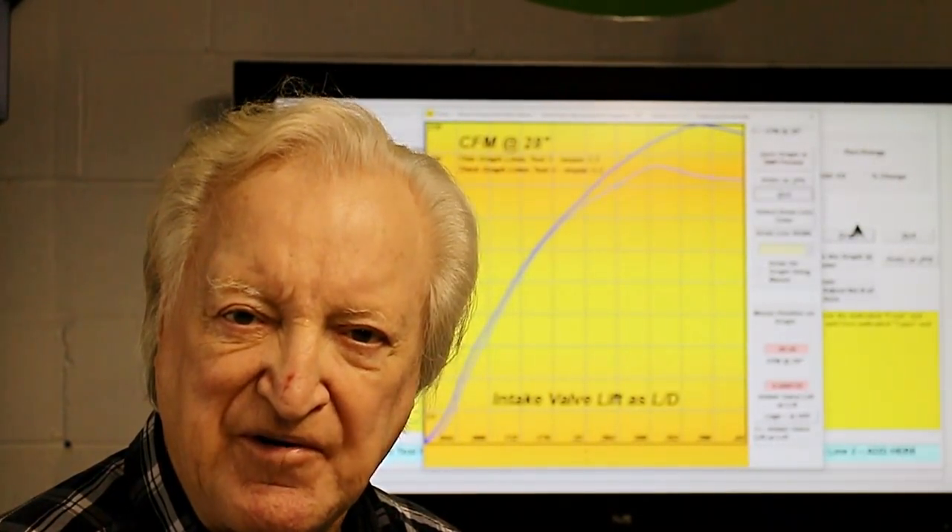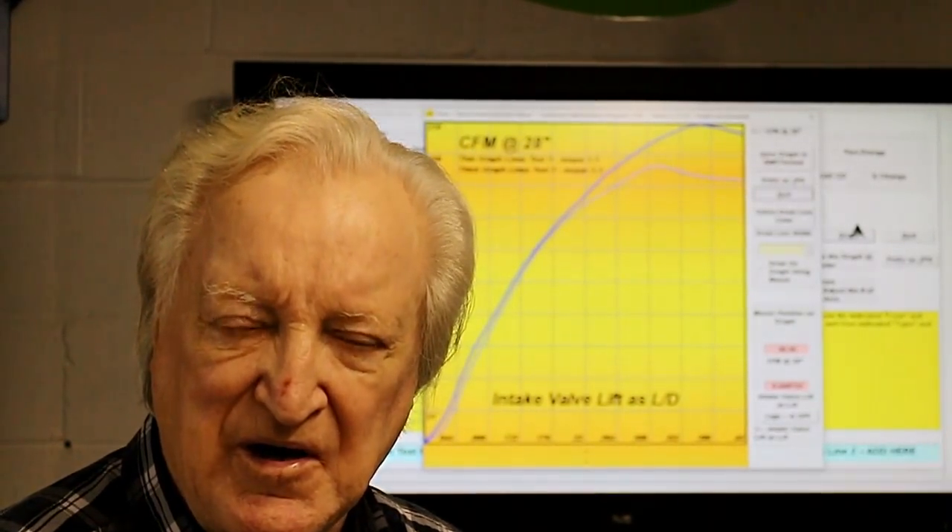So, why a 39 degree seat? It presents area to the cylinder faster and it makes the valve look bigger at low lift. But it's not just a case of doing a 39 degree seat versus a 45 — I'm going to talk about seats in an upcoming edition. Suffice to say, the 39 degree seat inevitably flows more, maybe for about the first 150 thousandths. If we went flatter, say to a 30 degree seat, it would flow even more.